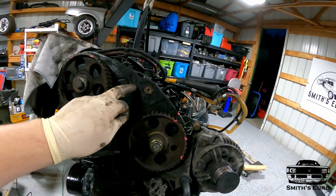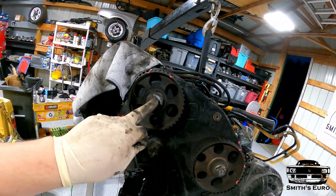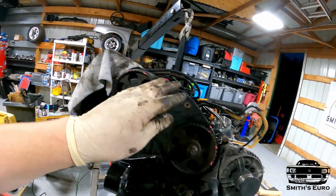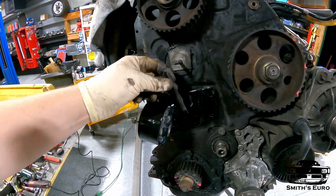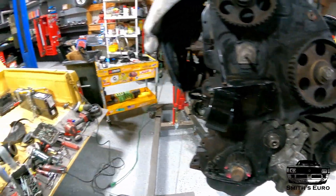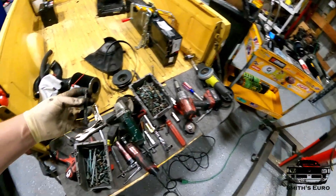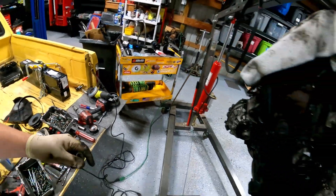So I didn't want to take this cover off because I don't have all the tools here with me right now and I don't want to re-time everything — if you break this loose it's free floating and you have to take the valve cover and lock the cam. So I just marked everything. This is probably the best way for most of you guys to do it at home. There's usually a ridged area that comes right down here — see where the gold mark is — so this ridged area on the timing cover I marked, then I cut it with a cut-off wheel, went all the way down, and used a flat disc to grind it flat.